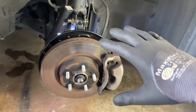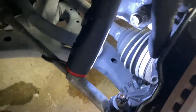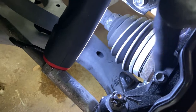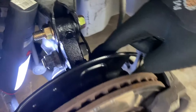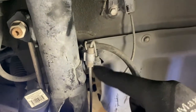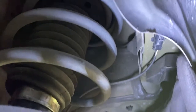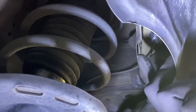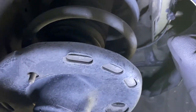I've got the wheel off because you're definitely going to need to do this, because this is your speed sensor. It's right here and it's just a little 10 millimeter bolt. That wire runs all the way up here, all the way here, so you're going to have to disconnect it from here. It runs all the way into the wheel well. If you can peel it back, see if I get some light up here — it's going to be right there. So that thing right there is where you're going to disconnect it.